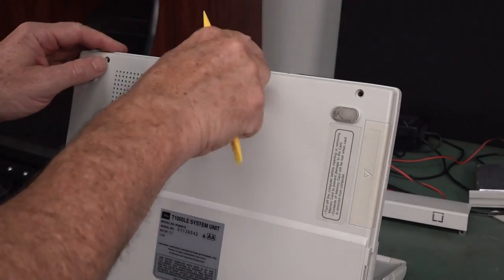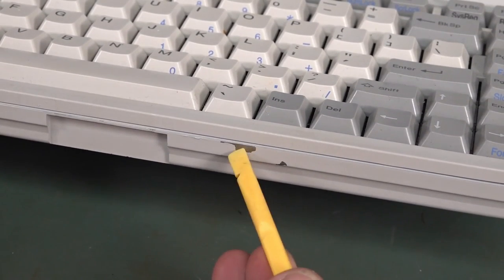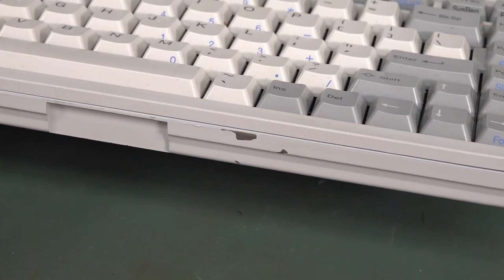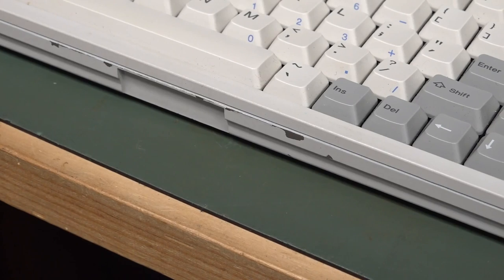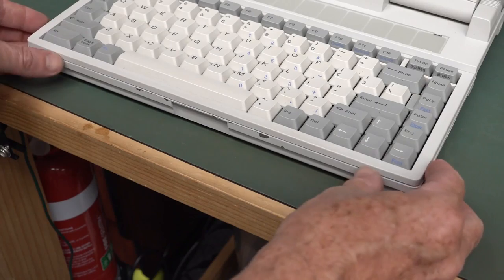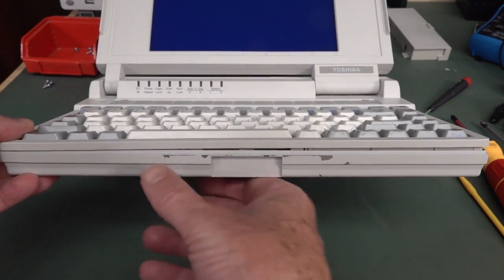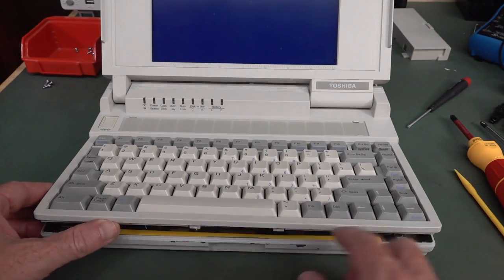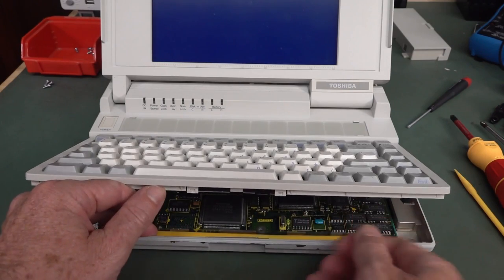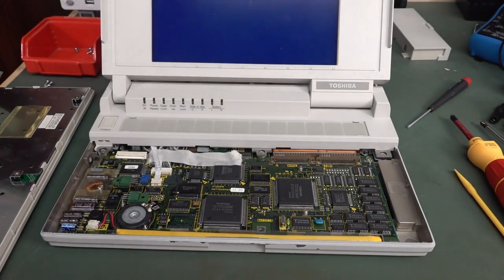You're supposed to take out three screws and the keyboard just lifts off, but it doesn't. Using my plastic spudger tool, more of the painted surface just flakes off - a real shame, it was in perfect condition. It's all starting to flake off. It turns out there are two plastic catchers under there that I couldn't manipulate any other way - I just had to get in there and slide the spudger. But anyway, there you go - we're in, keyboard's out.